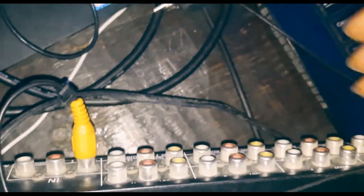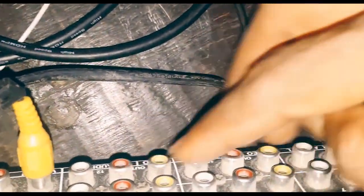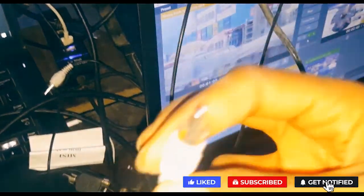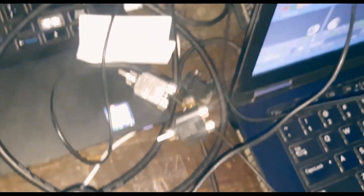For audio, bring in two more cords — the red and the white — and plug them into the back of your splitter. You can take audio out from any of the output ports as well. To project to multiple TVs, run AV cables from the splitter's output ports to each TV — you can buy 25-meter or longer AV cables. Just plug one end into the splitter output and the other end into your TV.